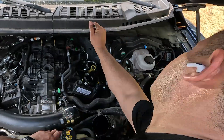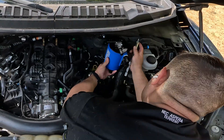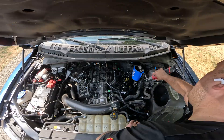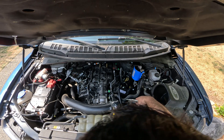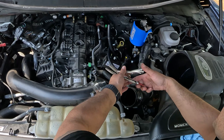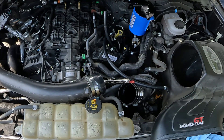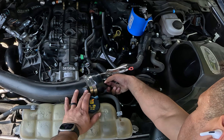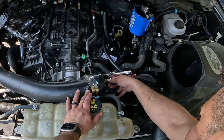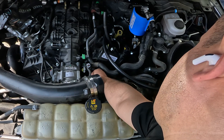Prepping the air oil separator, I added the hoses and removed the bolt and nut from the bracket and ground on the vehicle. Then I installed the AOS and prepped to remove the coolant hose from the block. The only reason the AOS allows you to recirculate the crankcase ventilation oil is because it has hot coolant running through it, which is supposed to eliminate or reduce condensation from mixing with the oil. I clamped off the hose, slid back the barb clamp, and popped it off the block.